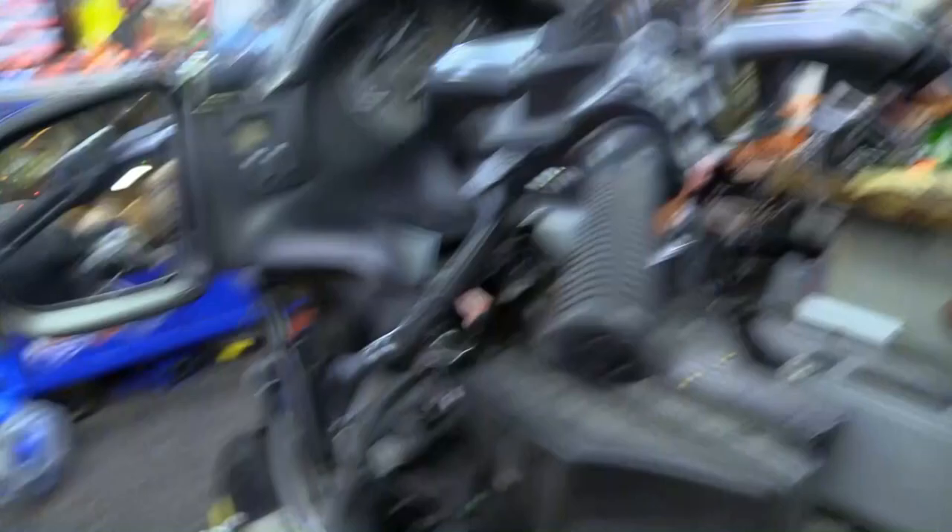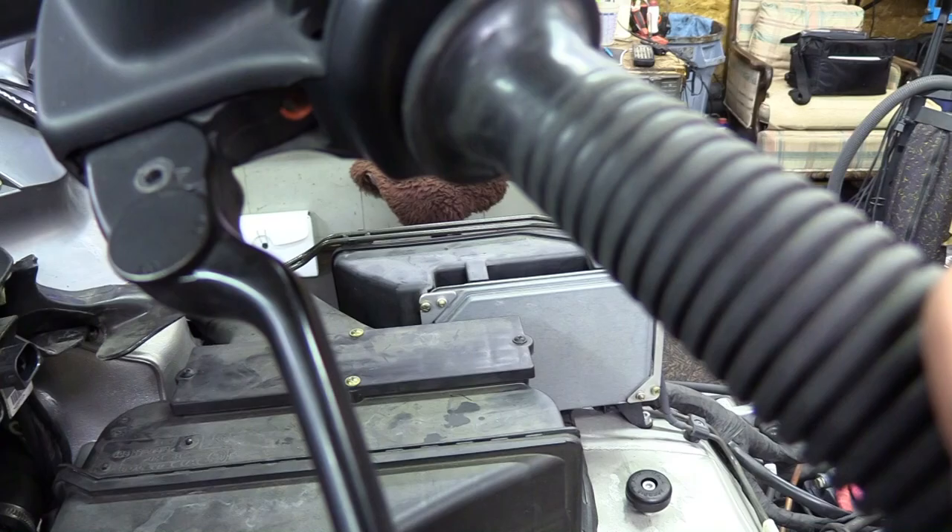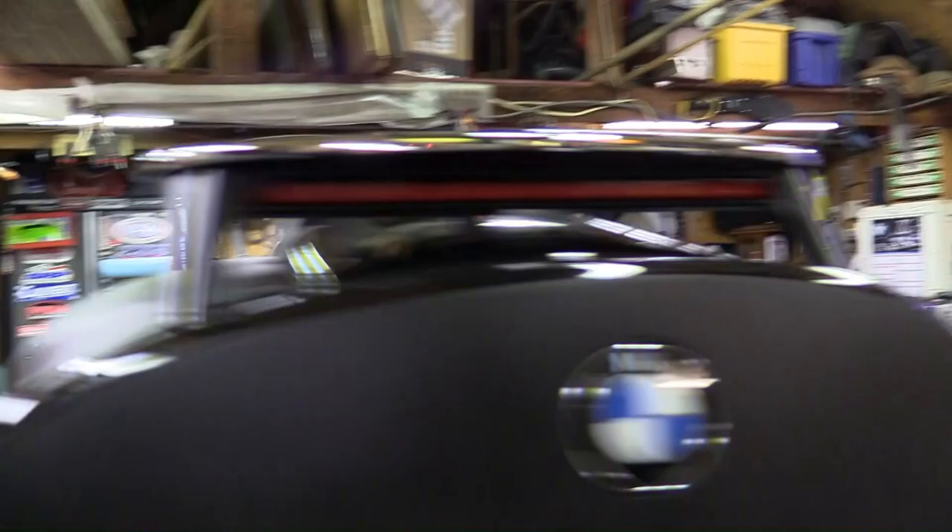So one of the things you'll need to test is the micro switches on your motorcycle — at least just verify that they're clicking. Inside of the clutch and both brakes there are little micro switches and you can hear them. You just want to make sure that you can hear them clicking. Do all the brakes — there's going to be one on the brake here, you can hear it clicking.